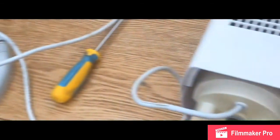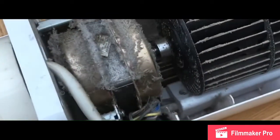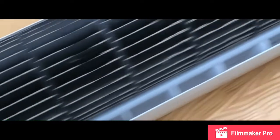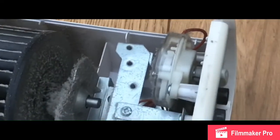I've removed the fan from the base. There are a few screws under here — just a couple of screws at the top and a couple of screws covered by these rubber bungs, which I've taken out with a flat blade screwdriver. And here comes the moment of truth. You can see it's quite dusty in there, none of which is going to help its efficiency in blowing air. So I think the first thing to do is get the hoover and suck out what bits of dust I can, and then we'll dig into the problems it has.